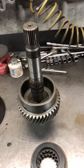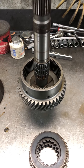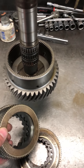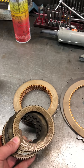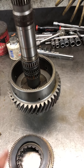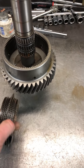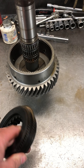This is a Velvet Drive 5000 input shaft. I don't have the full transmission here in the shop, but this is the guts of one. This is a transmission that can go either direction. Look how tiny the plates are — compared to a Velvet Drive forward pack, these things are small, but there are ten of them. It's much higher pressure: these operate at about 300 psi in forward gear, so they've got tons of hydraulic pressure to keep them locked up. You can see it's got a lot more holding power even though they're smaller.